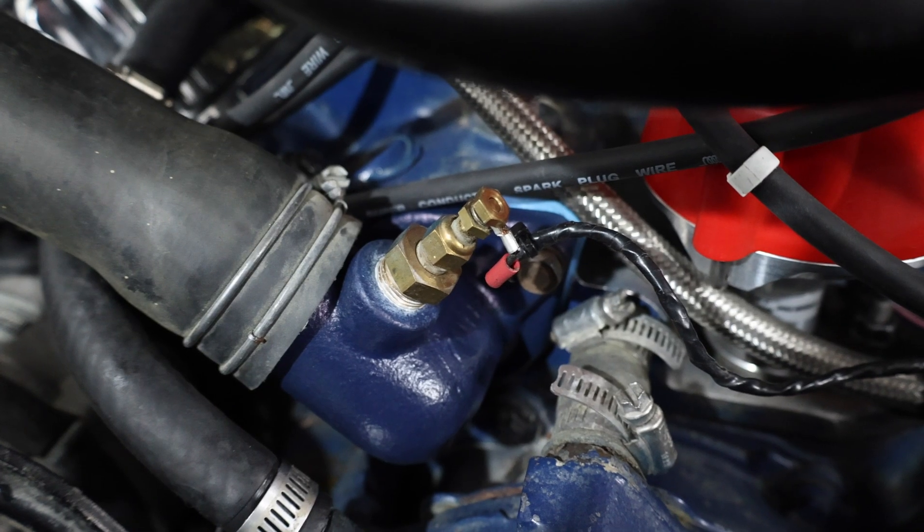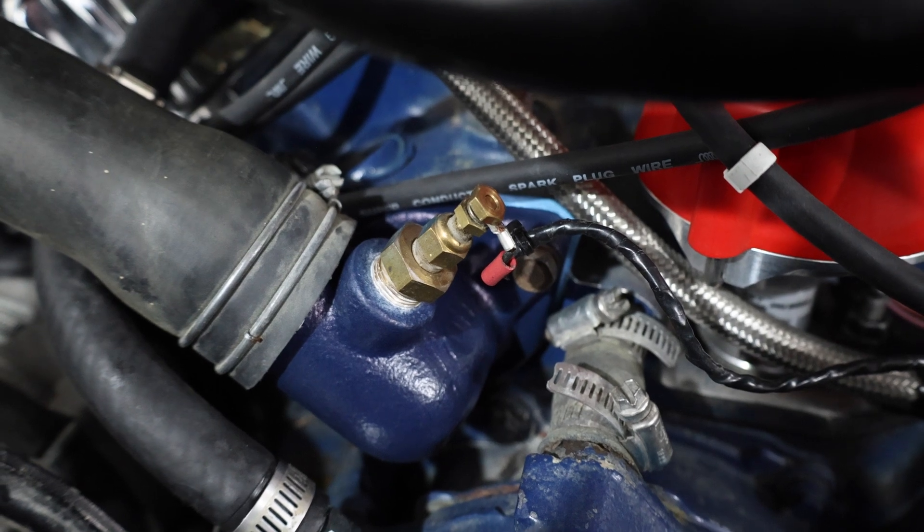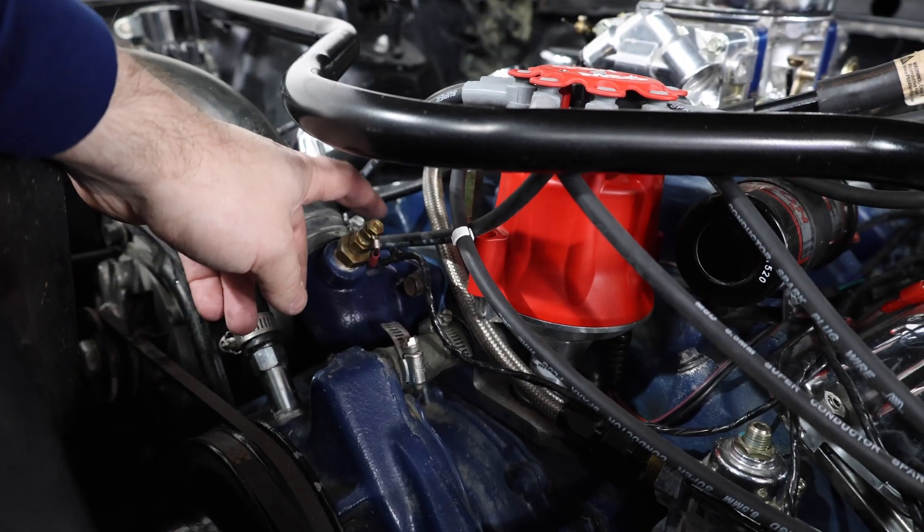We are installed. You can see the paint looks much better on it. Everything's in place and there shouldn't be any other issues. I'm going to fill it up and check for leaks. One thing I didn't show on video — you really have to torque it down to the right specifications for the year engine you have in your car. Make sure you torque it down so that the gasket seals. I mentioned making sure the thermostat is in that pocket — if it's not, there's a chance it could rock and potentially leak. I thought about putting a little gasket adhesive on it to hold the thermostat in place, which would be a good idea if it's loose like mine was. Now I'm going to put some coolant in it. Thanks for tuning in this week on Smacky's Garage — I'll see you next week.